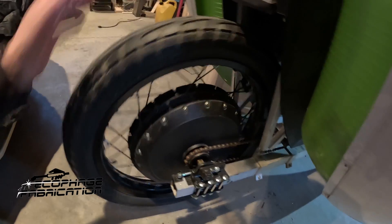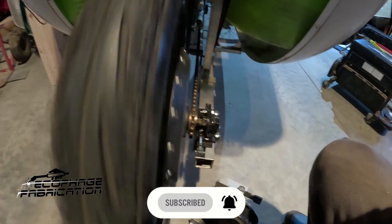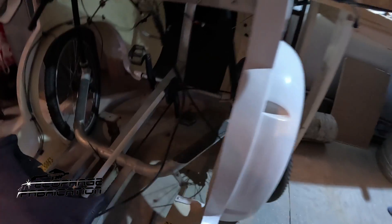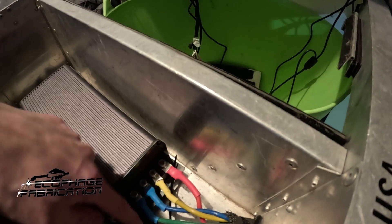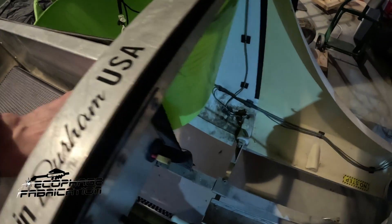Next thing we had to do is get this wheel aligned and get it freewheeling — as you can see it's all happily installed in there. We got the chain on there and it's running great up to the pedals. Next thing we did was route the harness up into the back of this box, which was in here originally. We went ahead and installed the speed controller in here and upgraded the lugs for the power supply so the 72 volts is going right into it with the same fat lugs.